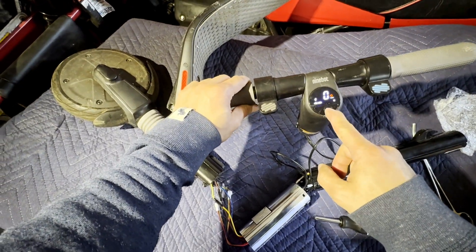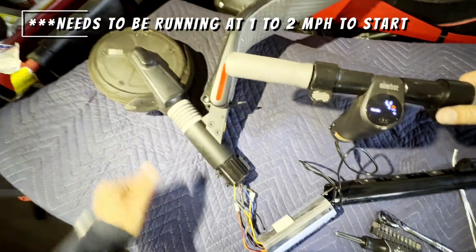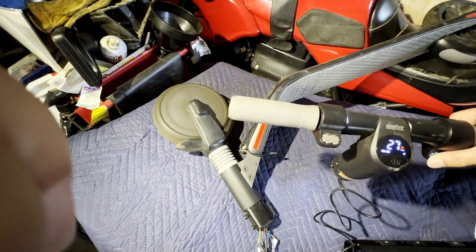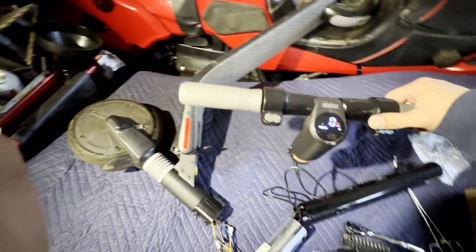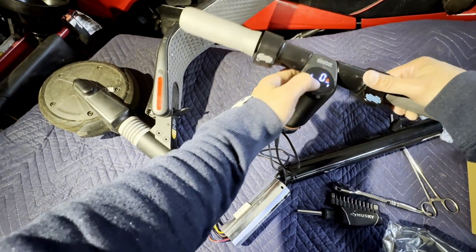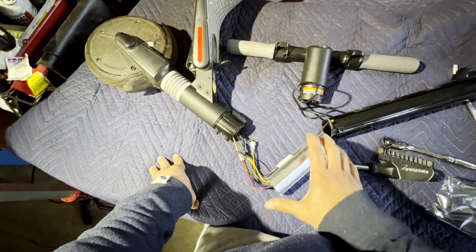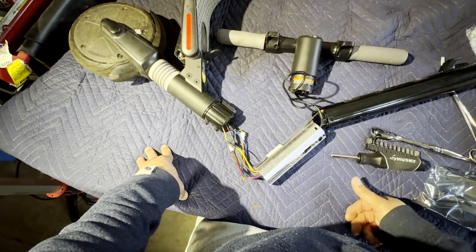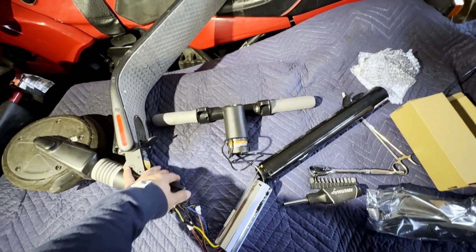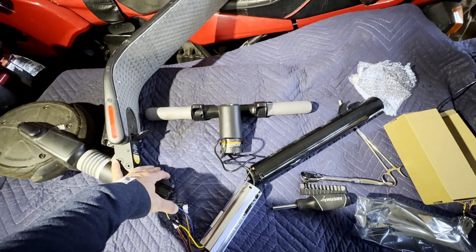So now the error code's gone away. Yeah, that's it — we got it going. You can see the wheels going. So let me go ahead and actually reassemble the whole thing. That's all it took. Even though it says it's a hall sensor, which is inside the motor, it's actually the control board which you can get on Amazon relatively inexpensively. I'll leave the link in the description below. And again, if you get an error code 18, that is the way to solve it. So let me put everything back together and we'll try it again.